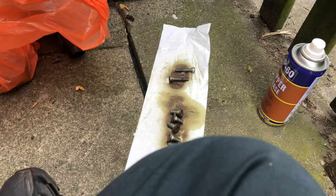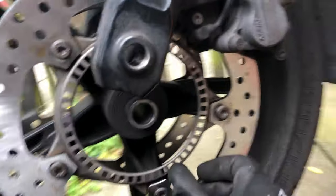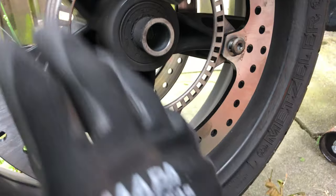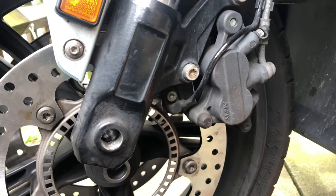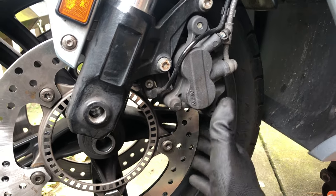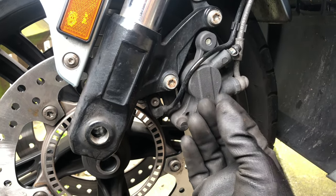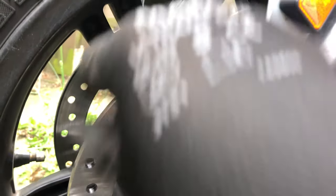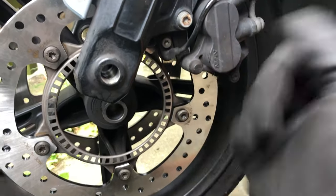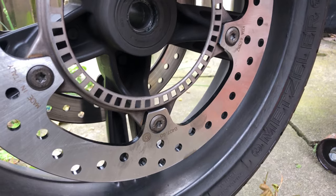I already noticed they were quite tight, but there we go - that should do it. I've just carefully seated this so far, putting a couple of bolts in. I'll put them in on the way as they need to sit properly. I actually do this with the wheel effectively down so I can get the disc out while still keeping both calipers in place. Before you take the wheel off it's good to wiggle the wheel a little bit to push the brake pads apart slightly, because when you put a new disc on it will be a bit thicker, so that means you can easily slide it back in.